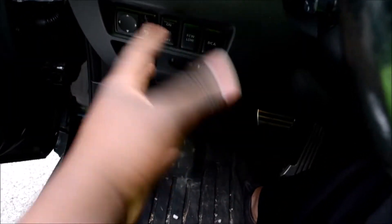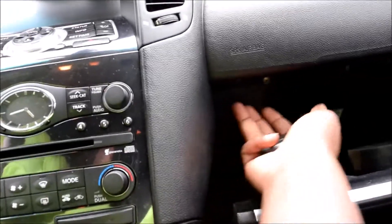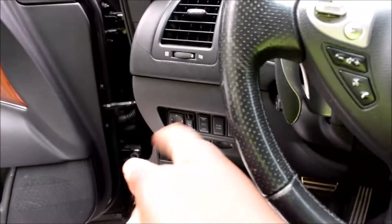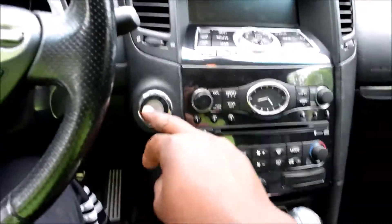On vehicles that have a trunk switch, they usually also have a trunk cancel switch inside the glove compartment. Basically when you toggle that cancel switch off, your trunk remote functions do not work — you cannot open your trunk using your key fob, and it likely affects the trunk pad button as well. So that's pretty much it for the trunk feature.